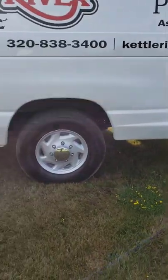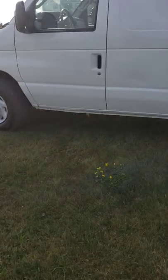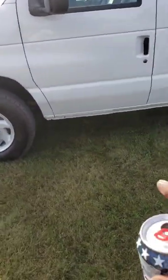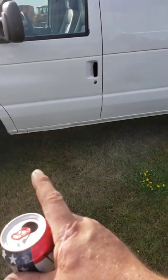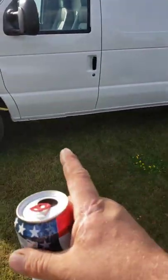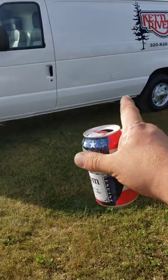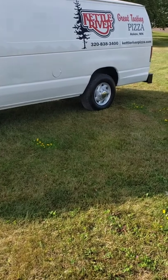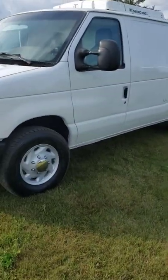Around to this side where we did some rocker panel repair down there. You can see the one right below the door — it sticks down just a little bit different than the rest. There's a reason for that because there's some structure there in the body and the collision stuff, and I didn't want to start cutting into anything there trying to make it fit flat. So we just overlaid the top of it and called it a day. That pinch weld was janky before — I took a one-inch strip of steel and put a couple series of pop rivets in there in the structural parts I could get a hold of and just gave it a little flash so it looks decent. 360,000 miles, and we're trying to stay on some sort of a budget here. We're not going to spend $10,000 trying to fix this thing — otherwise they'd be putting a down payment on a different one.